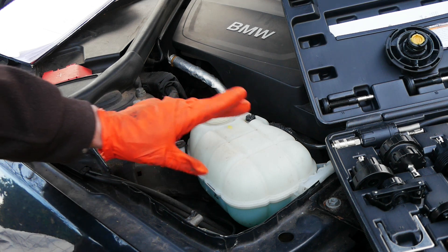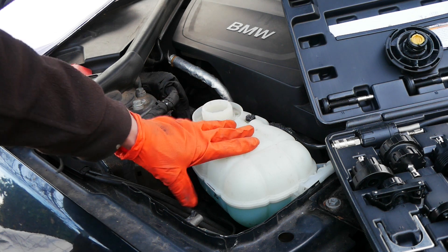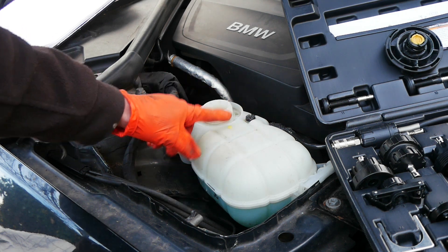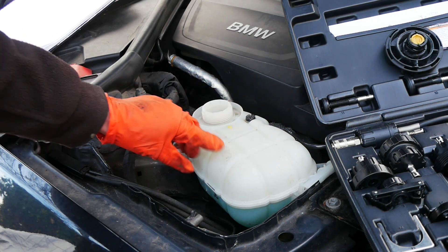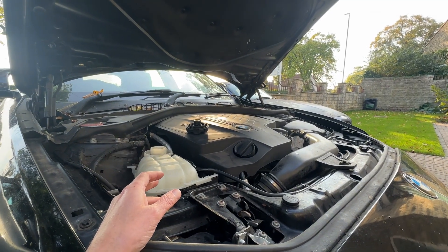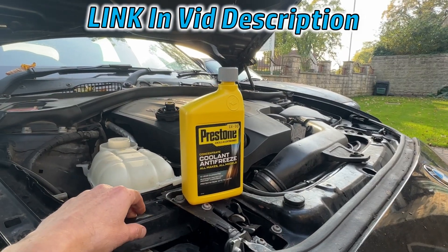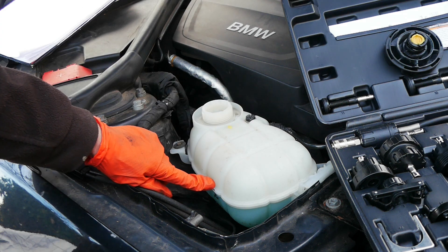You need to do this test when you've got plenty of fluid in the system, so if you've lost a lot of coolant you'll need to top it up with some coolant or with some water. If you're unsure what coolant is in your car or what coolant it should take, this Prestone is a really good option because it's compatible with all coolants. Mine's about half full so we're good to go.